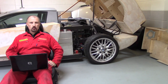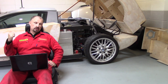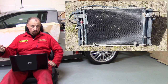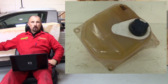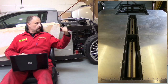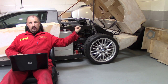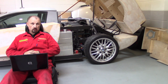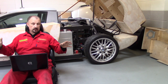To recap: this cooling system on the prototype comes straight from the donor car. It uses the original radiator with its twin fans and shroud, the expansion tank, two hoses that run down the centre of the car, and a loop at the engine to bypass where the heater matrix used to go. Pretty simple stuff — and this works. The fans come on and the car doesn't overheat.